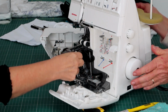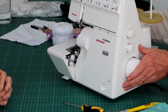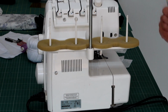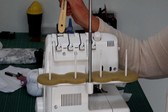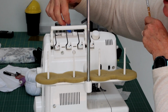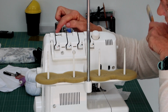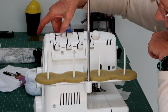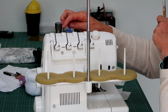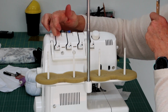Oh yes, and I just want to show you here. Thanks, Elsabe. I'm just going to close this. Okay, I'm pleased this is actually visual over here. If you can have a look, you'll see that this cover is actually protruding up. Okay, so this is when you pick your handle up, you actually knock it with your fingers. Okay, you need to keep it pushed in. There is a little clip, otherwise it does affect the performance of your machine. Okay, I didn't see that before. There you go. It's something that can happen by accident. So it's when you pick it up in a hurry, you just unhook it.